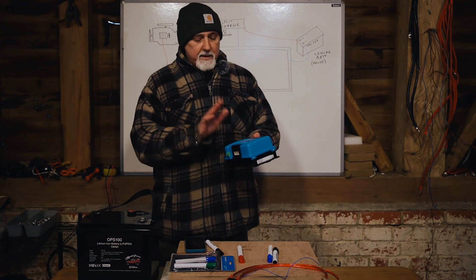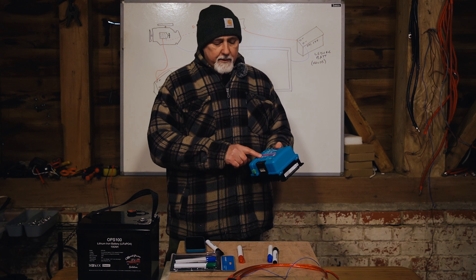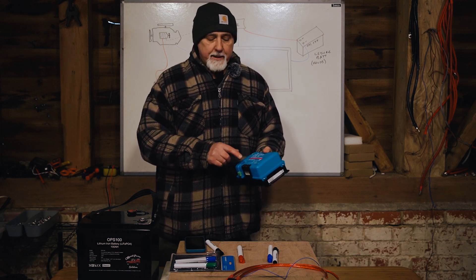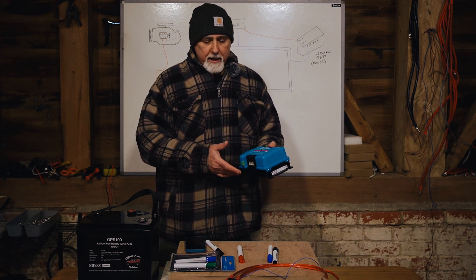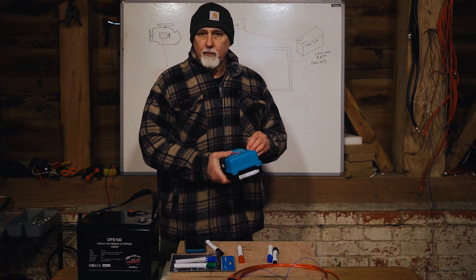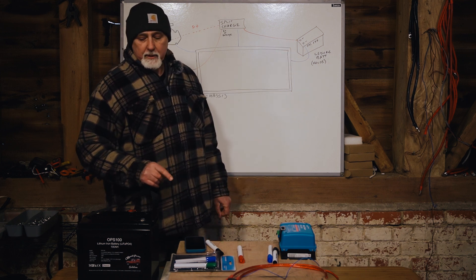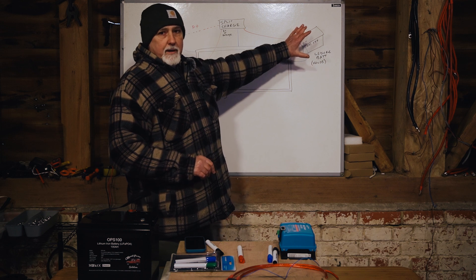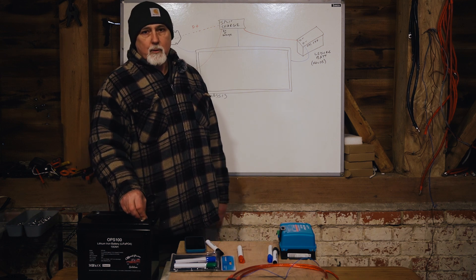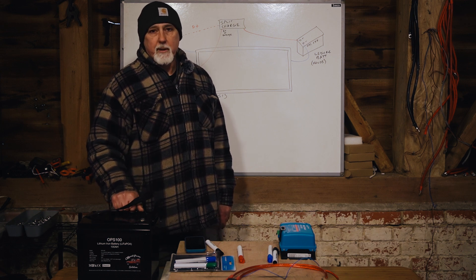This is what we recommend — use a DC-to-DC charger. This is the Victron one, very popular. If 30 amps isn't fast enough, you can simply put two in parallel to charge at 60 amps. If your alternator has the capacity and your battery bank is large enough, there's no reason you can't put two or even three in parallel. But I would not go for a split charge system with a lithium battery — you have no control over what's arriving at the battery or what it's drawing from your alternator. Nine times out of ten, or even 99 out of 100, you might be fine. But if you're that unlucky hundredth time, things could go very badly wrong and you could even burn the vehicle down.